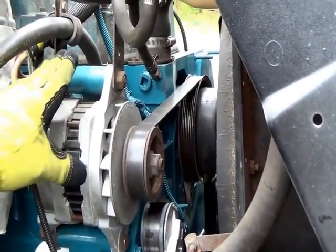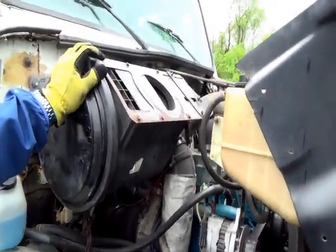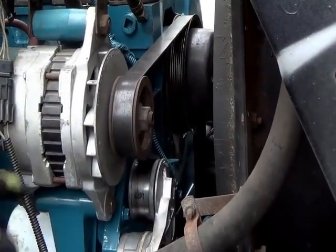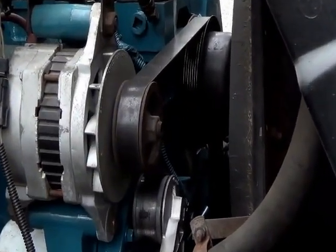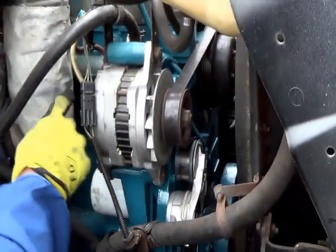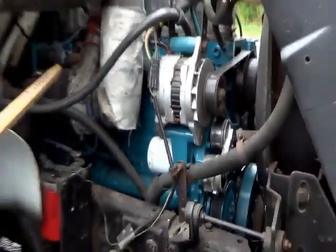Next part is your, now let me just say real quick, this air filter, I know we said from right to left, top to bottom, but any air filter you do not have to mention. Now, so we go down to your alternator and the alternator bracket. It's not cracked, not broken, and secure. No illegal welds. It's belt driven. The belt should have no more than 3/4 inch play, so you want to tug on it, and it's not dry rotted or frayed. Your alternator cables are not cracked, not broken, and secure, and not dry rotted or frayed. Then you go to the exhaust.